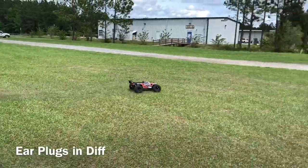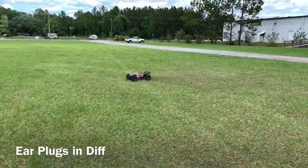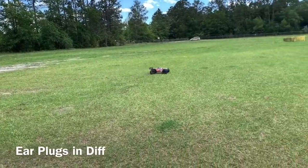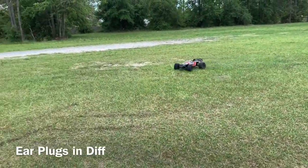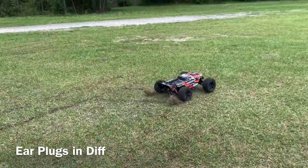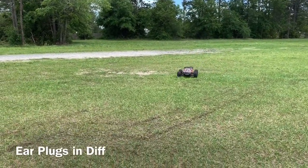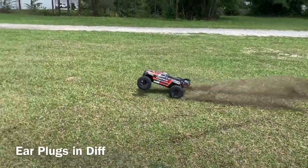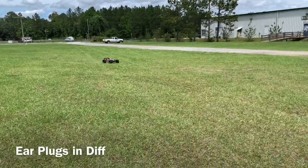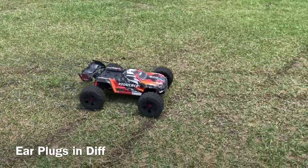It definitely doesn't expand the front tires anymore — keeps them pretty much at the same speed. Notice what it's doing though — it never did that when it had the diff oil in the middle, which just sent everything to the front. This is more fun obviously, but when it comes to racing you actually want that front end to overdrive the rear a little bit because it helps keep you straight.